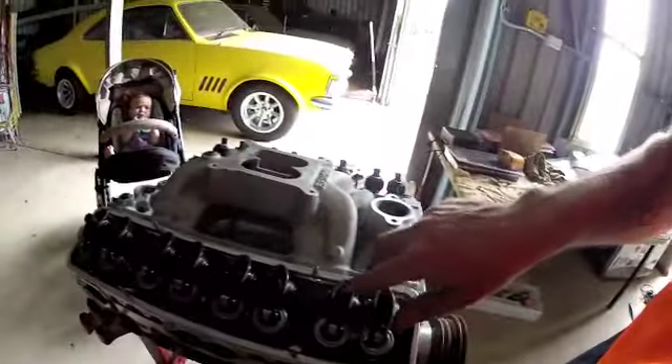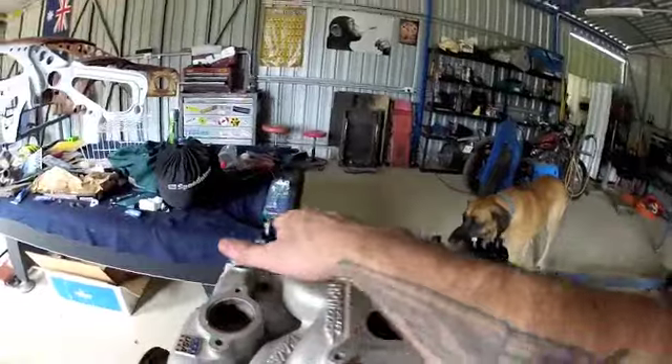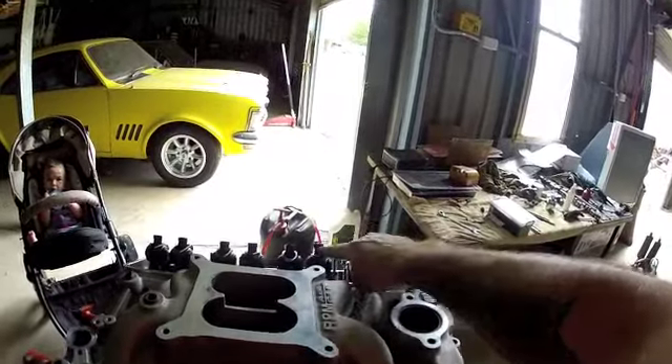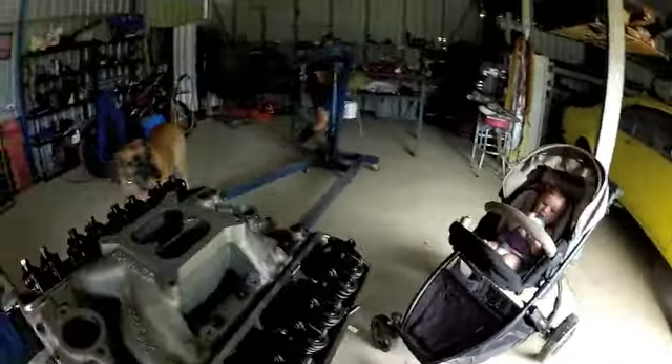Just double check things when you're all done - go along and see all your locking screws, see if they're all about the same sort of depth, or even just look at them in a plane. And you can see on this side how this one's higher. So I must have stuffed something up - I think I must have put it on upside down. Look at this.